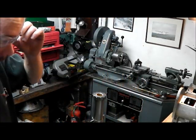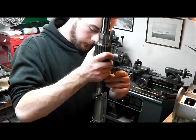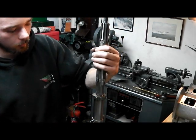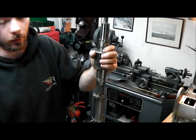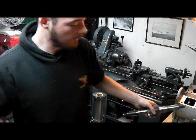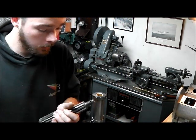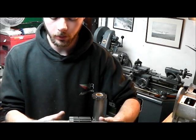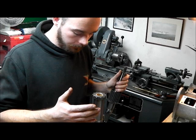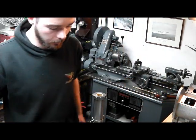So we're nearly there, flush with the end of the shaft. It actually needs to go a little further though - the position isn't terribly critical, but as you can see at the moment if this shaft is as close as that it'll be riding the radius. The bushes as installed tend to be about one to one and a half millimetres below the edge of this surface. The position of the bush is not that critical provided it isn't covering the oil hole. This shaft is retained by a bearing either end, so this shaft should not be floating towards this one, and we just need to find a way of driving that a little further in now.